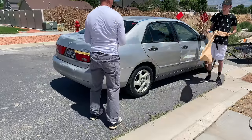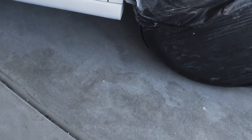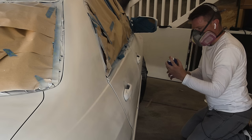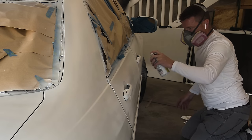My second tip is to do this inside a garage if possible. If you have to do it outside, make sure it's not a windy day. It didn't make much of a mess — I didn't put anything down on the floor and there was just some dust we swept away when done. My third and final tip is to check the nozzle of the can from time to time. We started getting some drips that fell onto the car. If you're trying to get a really nice even coat, those drips can run and make a mess — it's not from over-spraying, but from a drip that collects at the nozzle and falls off. Just keep an eye on that tip, carry some paper towels, and wipe it off as you go.